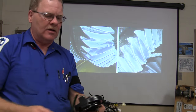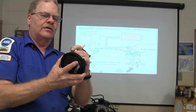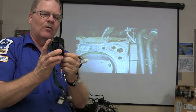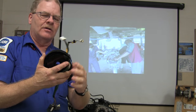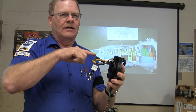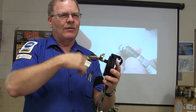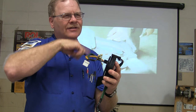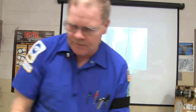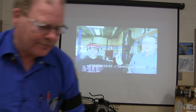This right here is another clock spring, by the way, that's intact. See how you can roll it and it stops? If it's all the way to the stop, what you're supposed to do when you reset it, and I meant to say this a while ago and dropped the ball, is turn it all the way until it stops and then go back 2 3/4 turns. That way your steering wheel has all the turns it needs. That's what you do on that typically. All right, just remember that. And that one there wants to keep falling on the floor.